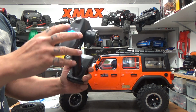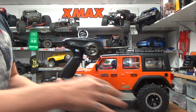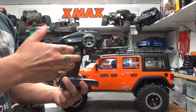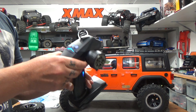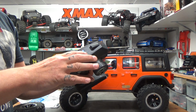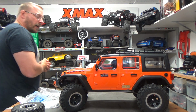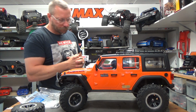It's also good because with the light you can better see if it's locked or not, and if you put the truck on its side, turn the power off and on again, it goes back to unlocked. So you have less issue with driving in speed gear and forgetting to unlock the front differential. It's not a big deal on slippery surface, but don't forget to unlock your differential on hard surface like really grippy grass and concrete.